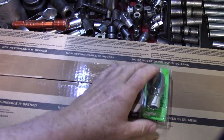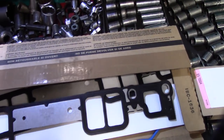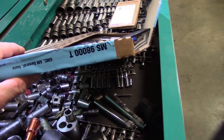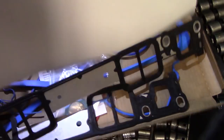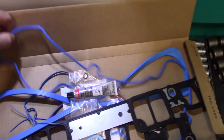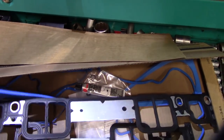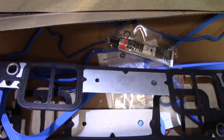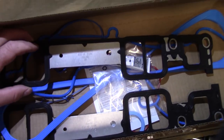This is kind of old-school stuff — we don't see a lot of them anymore, but they're still out there. I want to talk about this updated gasket set: the Felpro MS98000T kit, which includes one valve cover gasket, the upper plenum, the throttle body, and updated intake gaskets.